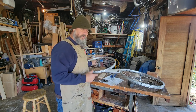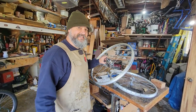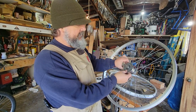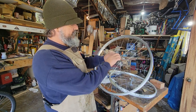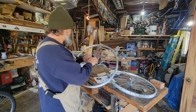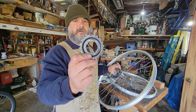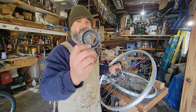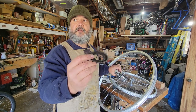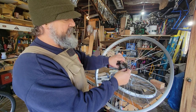The thing about a red band coaster brake — I hope you can see me here — is that they take a proprietary cog, which is real thick steel, fits in here and slides right on. Modern cogs won't fit. This is the sort of thing you'll see on the Shimano D-Types, CBE 110s, the Suntour coaster brakes, the Motocross coaster brake by Shimano. Even the Chinese ones — they all use this same exact cog, and that will not fit on here.